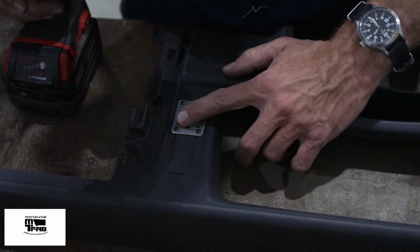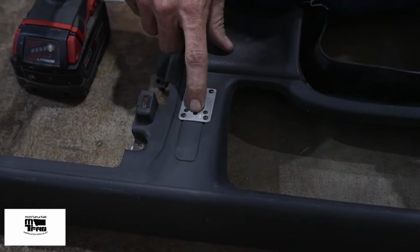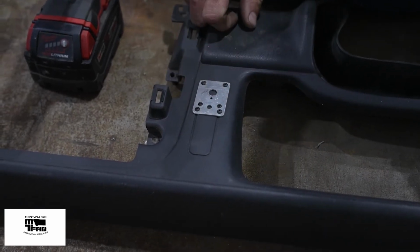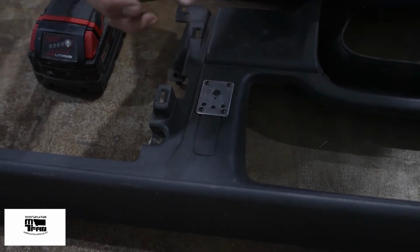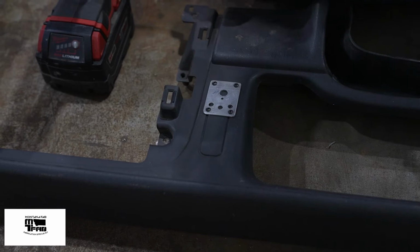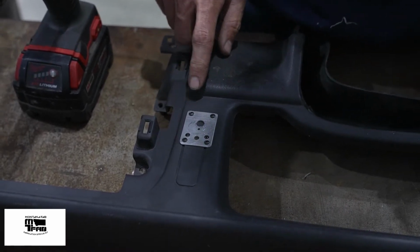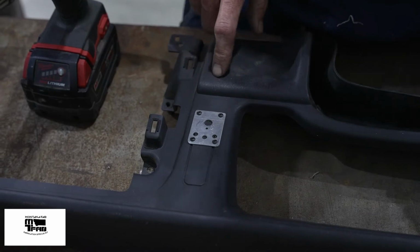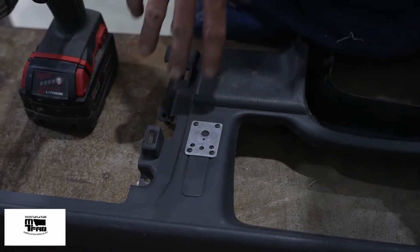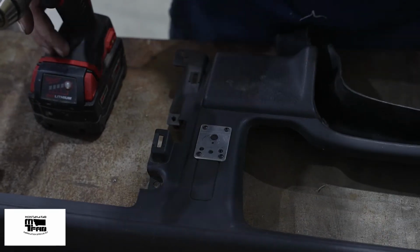I'm going to drill all 3 holes with my unibit because even though we spec'd out a 1/4" drill bit, these are 3/16 holes. We want the hole in the plastic a little bit bigger so that you don't get little crescents when it lights up in the back. Also, our plate is not 3/4 inch in diameter. So we're going to use the unibit to follow in this plastic. I'm going to eyeball the center, and as the bit hits the metal, it will kind of automatically center.